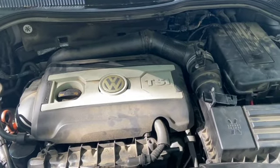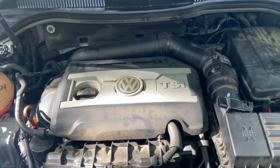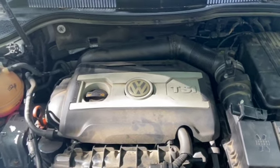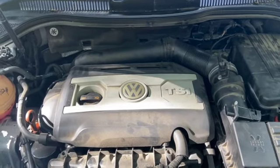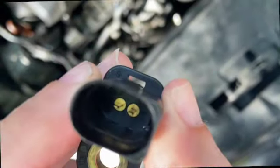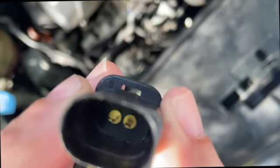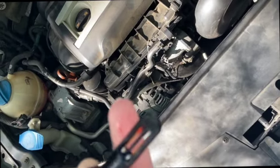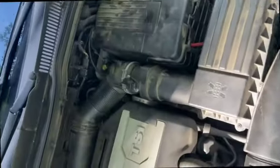I knew it was not my transmission and not a very serious engine problem. You do not want to have misfires. Here is what the air charge temperature sensor looks like — as you can see it only has two connectors, which means it is not a mass airflow sensor. It kind of looks like one, but clearly it is not. So misfires can be caused by both this sensor and by the mass airflow sensor.